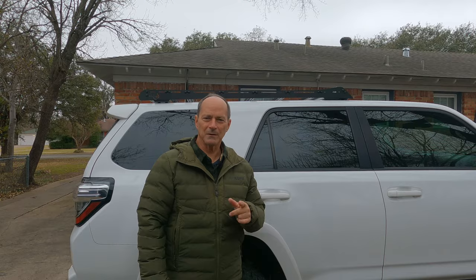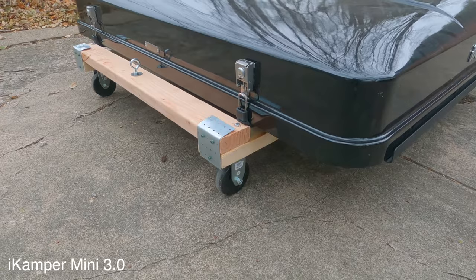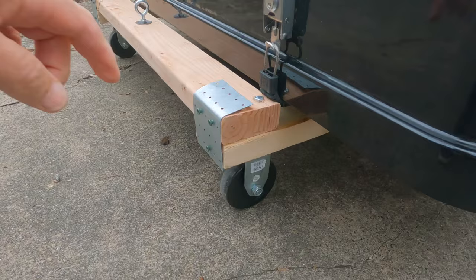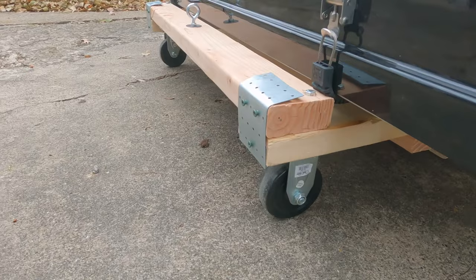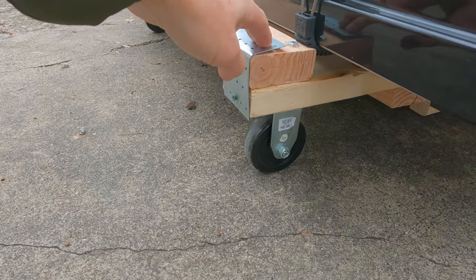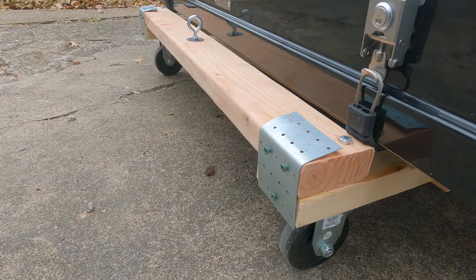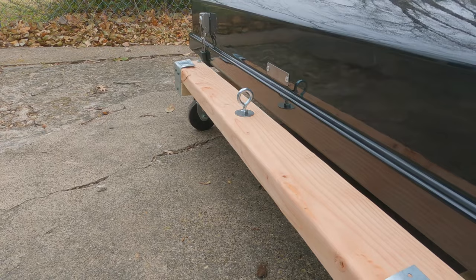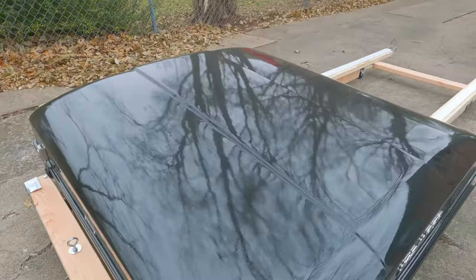This is the iCamper Mini already on the ramp. I've made it out of two-by-fours and I'll show you more details later. I'm using this two-by-four on top to act as a stopper — when this thing slides to the back it'll stop right here. I probably should put another board up here taller just as a safety measure. I've reinforced this because it's the lifting board, and since it was only bolted in with lag bolts I decided to strap it down a little tighter just in case. I have an eye bolt here where my winch is going to hook — not the winch on the truck, but my own winch. I put some wheels on here so I can easily roll it around.